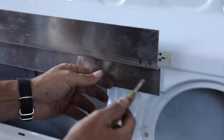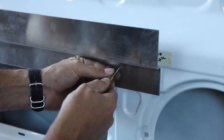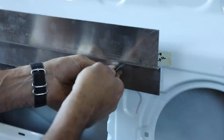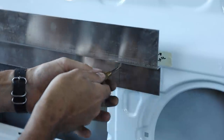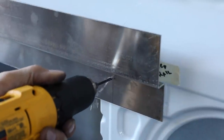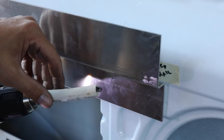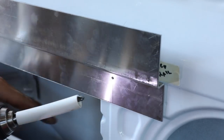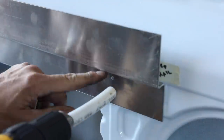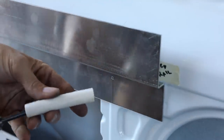We're ready to drill our first hole. Be sure to use a center punch — these spring-loaded center punches are wonderful for keeping the drill bit from wandering, because these screws will be exposed once we get the upholstery on and we want everything looking nice and uniform. For a pilot hole, start with an eighth-inch drill bit, then a quarter inch. Here's a trick: use a drill stop or drill guide. I made mine out of a piece of half-inch PEX pipe. Because as the drill bit presses through, it'll pull with your weight behind it and put a big dent on your bodywork on the outside — that'll just break your heart. The drill stop prevents that.